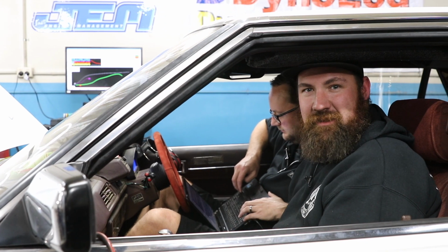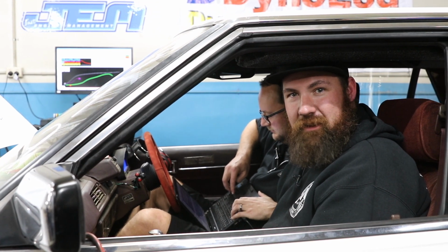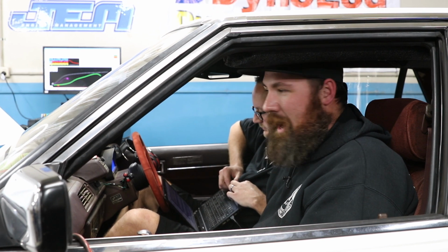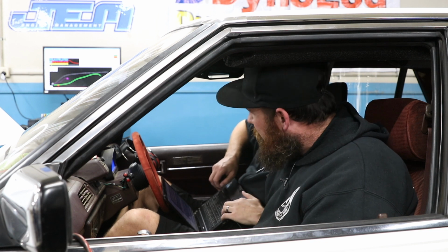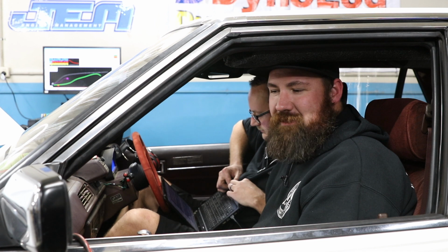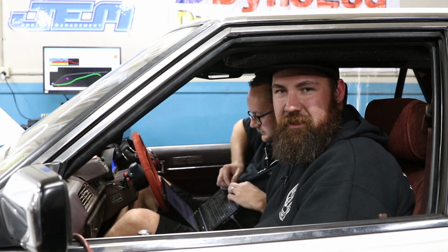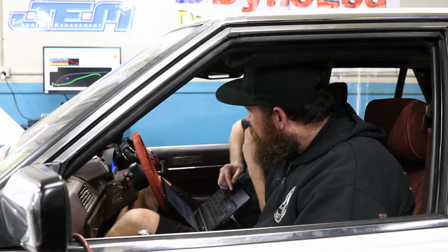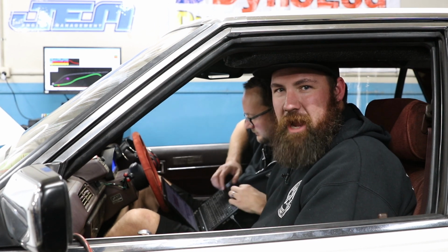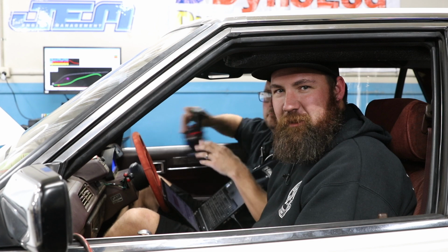That was our first pull with the new configuration. Scotty smashed a couple of numbers in. That's just wastegate pressure, which is 24 PSI. And we've already done 895 horsepower, or for our metric friends, 667 kilowatts. So that's the most this car's ever made by a fair chunk. It's pretty exciting, and we're only just beginning, so we may be jamming over 35 pound in this, so we'll see what happens.